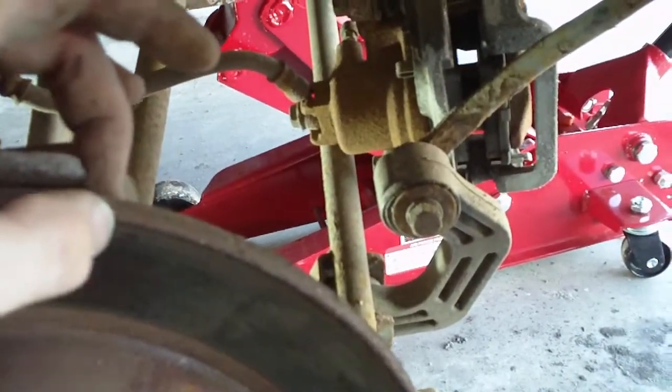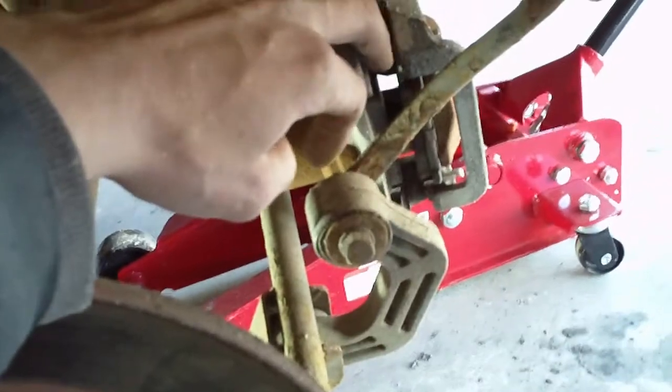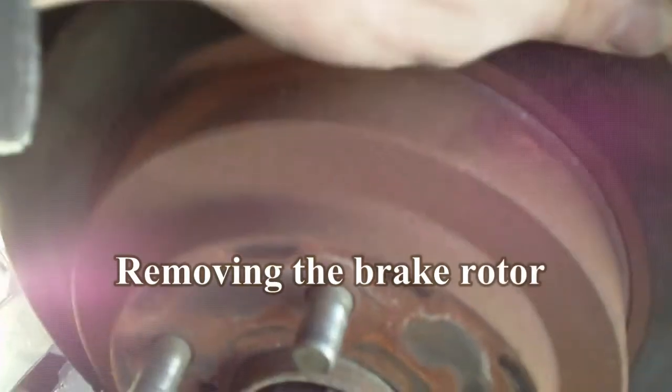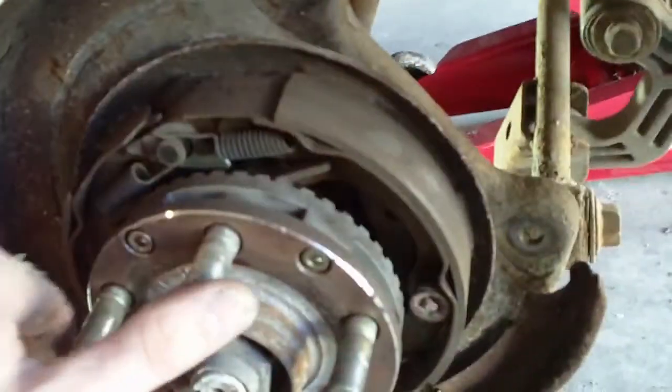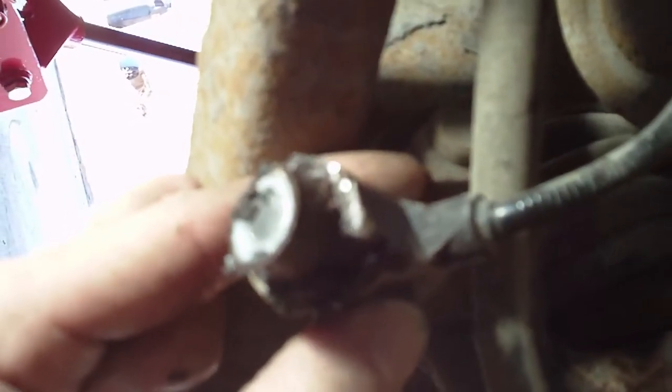If your lip on your rotor isn't that bad, take them off halfway so the pads are half-contacting, then just twist the rotor a little bit. I got lucky this time — it's just gonna come off. When you take it off you'll notice there's another set of brake pads underneath, and that's your emergency brake.